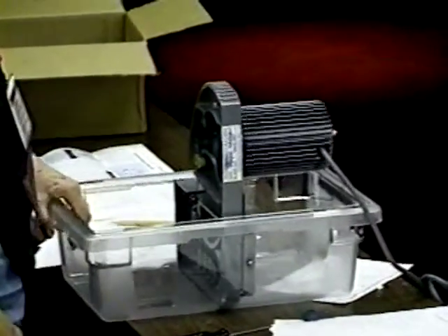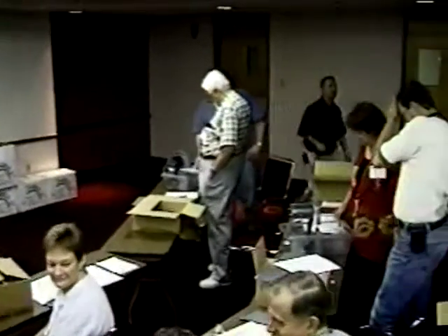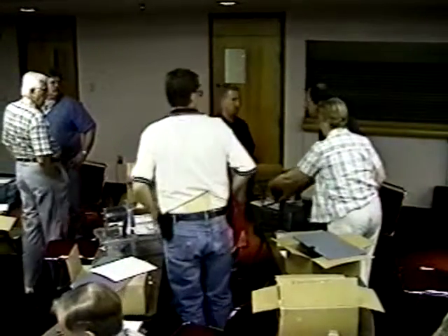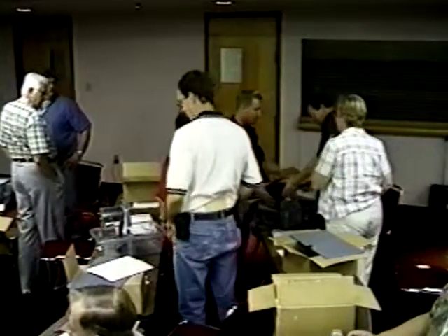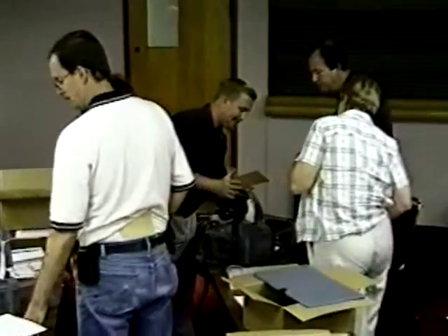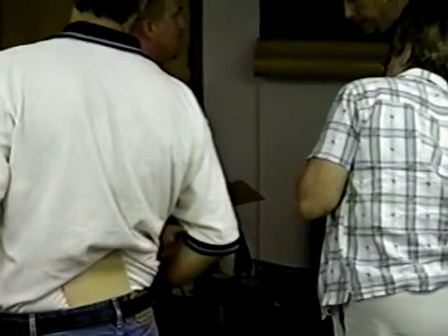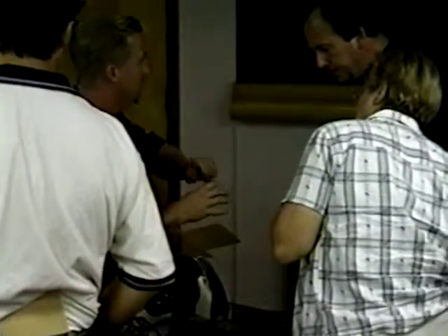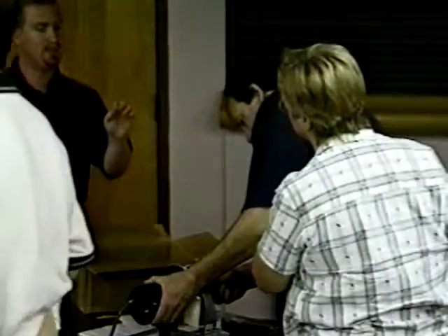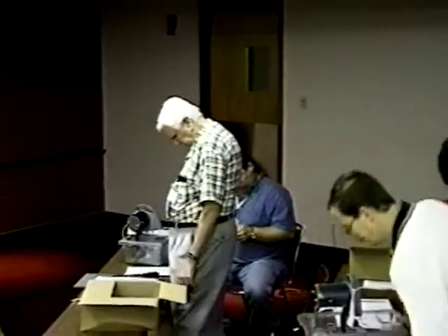Does it feel a little bit looser now? It sure does — not by much, but a little bit. It's a very minute amount. If you had it a little bit too loose, it sags and the drive gear is touching the body. When you lift it up, you've got the drive gear off the body. Just about two to three turns with your wrist is all you need. If you do it too loose, you get a false indication of how it feels. Make sure just a couple turns — everything is just a couple of turns, just loose.